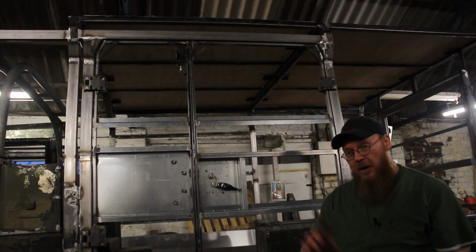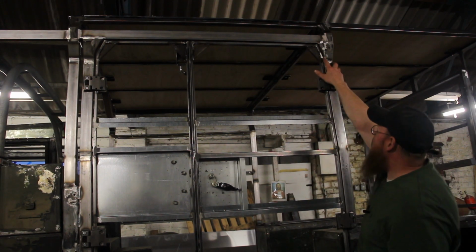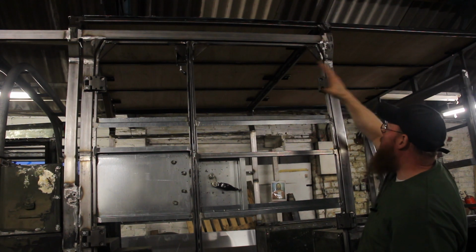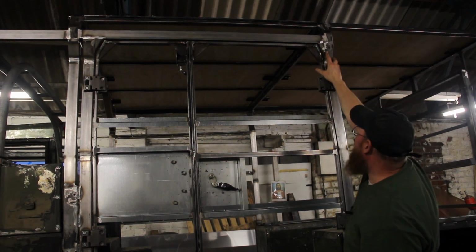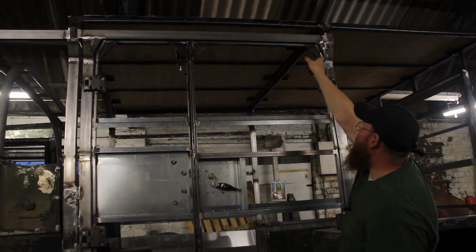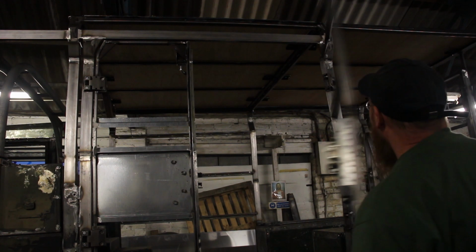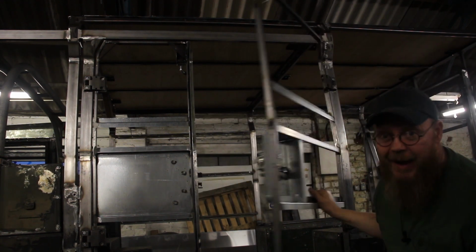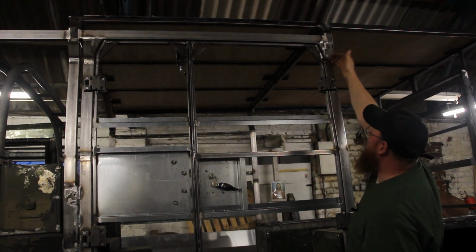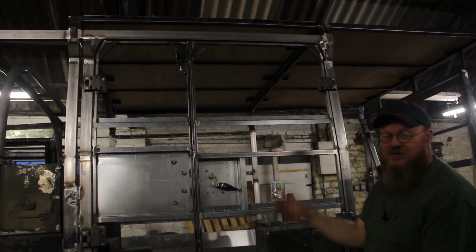And just on a quick note, putting another piece in here, what I didn't mention about the doors: if you look at the angle there, I thought when it opened up it would clear the corner here. As it came out, it didn't. It literally just dragged itself straight into it. So I had to chop the ends off and put these chamfered edges on here, and they're both the same. So when I open it, it just clears, and it actually looks quite good, I think. So that's why those are like that. I thought they would clear because obviously it comes back out, but it didn't. It just caught at the top as it started to come around. So yeah, that as well.